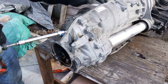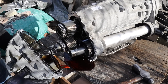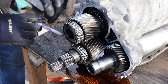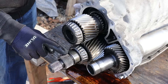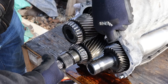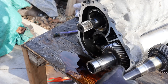Next up I'm going to get this transfer case housing off — there's a bunch of T40s. Taking a look at these gears, notice they're slant-cut which is going to reduce noise. This here is the output gear that comes from the transmission and it's directly splined to the input shaft of the center differential. Inside of that gear we have this shaft which is actually the input shaft going to the front prop shaft. You can see it's linked to a gear inside of here which in turn is linked to a counter gear that goes to this front prop shaft — this is the output of the center differential going towards the front prop shaft.